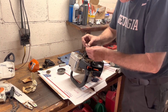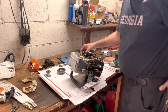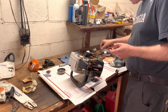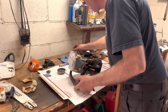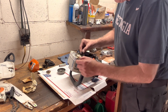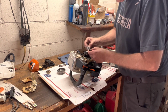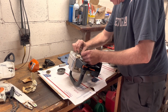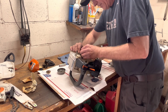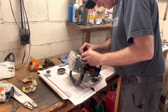Okay. Then your glide. Let's do an oil pump. Where'd it go? There you are. All right. The larger hole goes in the bottom. This will only orient one way. Slide that in. I like to hook up my oil line first and then walk this back over.